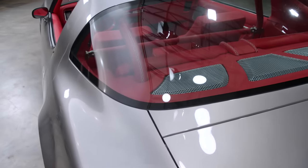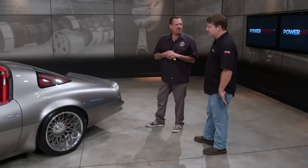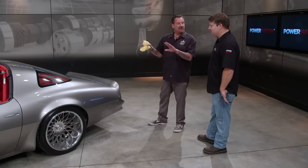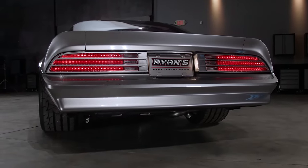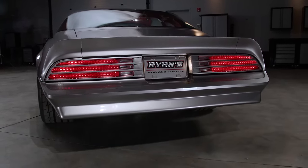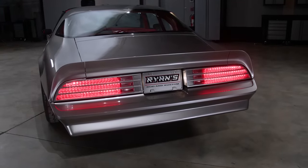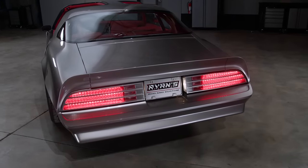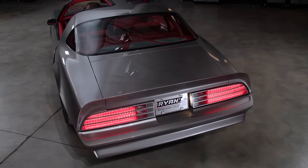One of the biggest things people notice is the flush mount glass. Did you use the stock glass to make that? We built the car around a piece of prototype glass, hoping it would fit — and we can move metal and paint, but we can't bend glass. It fit very well when we got it, so we were pleasantly surprised. Back here on the bumper, that thing isn't stock. I think it somewhat emulates a stock bumper, we just cleaned it up. The bumpers on these fit horrible, and they were plastic and much wider. So we took an inch and a half off each corner of the bumper and moved them in, then dropped the quarter panels about an inch and a half on the back to make them more level so it doesn't have that ugly kick up.